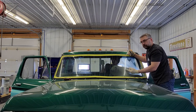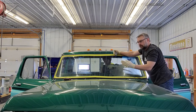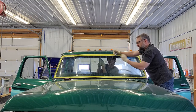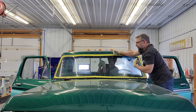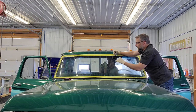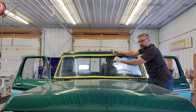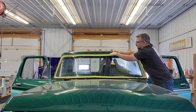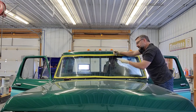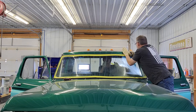Joe just said he's trying to control the speed of the pull. If there isn't a whole lot of the lip coming over and catching over the pinch weld, you can actually pull the rope too far without having an effect on the gasket lip. Sometimes what we've learned is you get that lip pulled barely over the whole pinch weld, and then you can work on the outside kind of pushing and rolling it, and you get that gasket to just kind of roll into place.